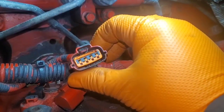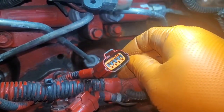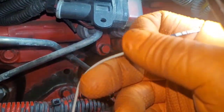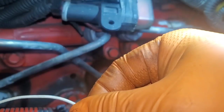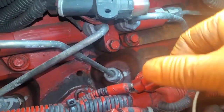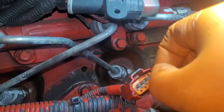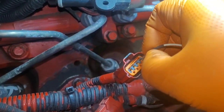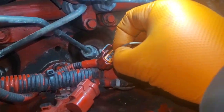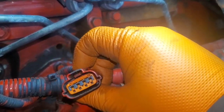The connector looks good — no corrosion in there. I'm going to test for an open or loose pin, and I've got the right tester, which is Cummins number 5299368. This will test to see if these pins have the correct amount of drag on them. I got a little bit of resistance there, so that's good. This one has resistance, this one has resistance, and this one too — so these pins are tight.